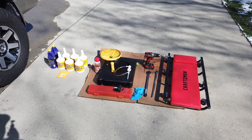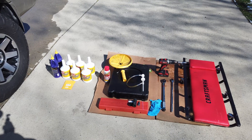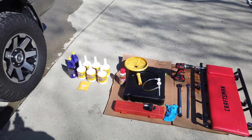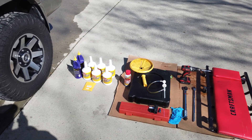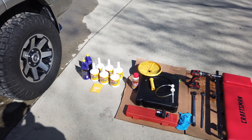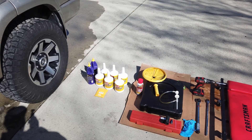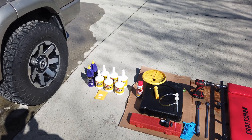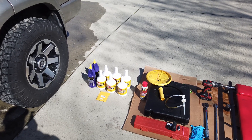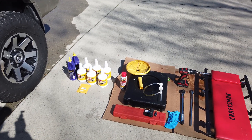You can probably get it done with what you have. We've got a small hand pump so we can easily get the fluid in, a drain bucket, PB Blaster — go ahead and PB blast your fill and drain holes at least 20 minutes before, typically overnight is recommended. We've got our Redline 75-90 oil that I'm going to use in the front and rear diffs, and Royal Purple Synchromax for the transfer case since it's matched closely to the Toyota differential oil. I've got a little pack of gaskets too.